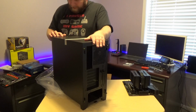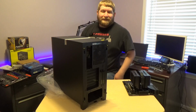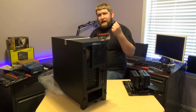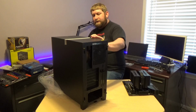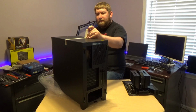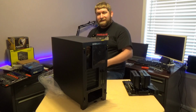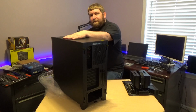We have a power button, a reset button, a TRRS. I'll go and sit down. I realize I'm not on there. There's a TRRS connection on here, guys. That is a 3.5 millimeter jack with the ground, the left and right channel, and the microphone channel as well. It'll have 4 points on the connection instead of the normal 3. I originally had issues with the mic not working with the headset, and I could not find anywhere on the internet, as hard as I tried, why it would not work, and come to find out it was the type of connection between a TRS and a TRRS. You can look that up online now with that information, very easy to find.